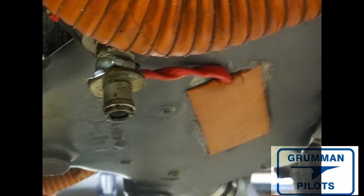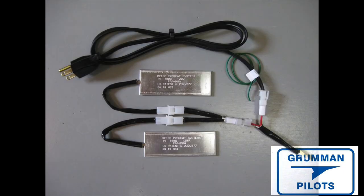Another category of answer was sump heaters. There are a wide variety you can buy for your oil sump — they come in strips, they come in pads, held on in different ways, but they all plug into electricity. If you've got a way of getting electric to them, they can heat your sump, which is one way of just warming the oil if your climate isn't too bitterly cold.